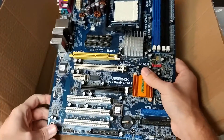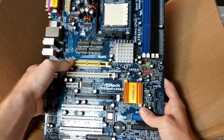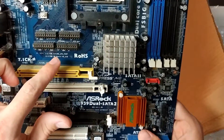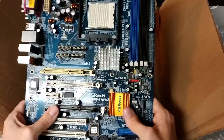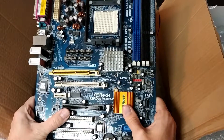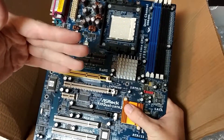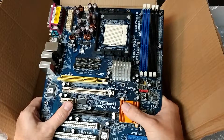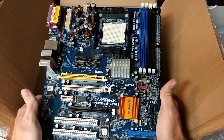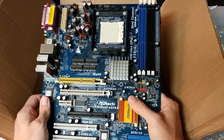So this one is also rare and hard to find — I had to get it from France. It actually has another mysterious slot up here. This is for — I'm not sure if it shows up — a 'future CPU port.' That basically indicates there was a sort of daughter board you could get for this where you could use an AM2 socket CPU. It was an entire daughter card where you could mount a CPU; it had its own RAM slots and you could put your own cooler on it. You probably won't ever see those anywhere. And it doesn't support Phenom processors anyway, so really it's just best to stick with the socket 939 socket.